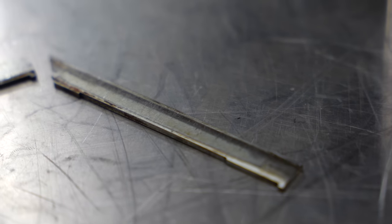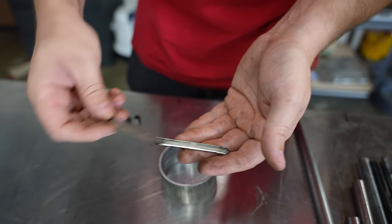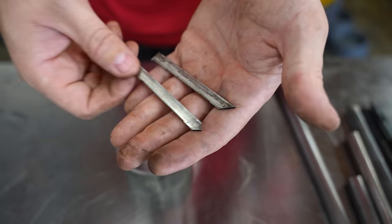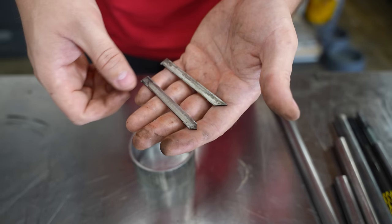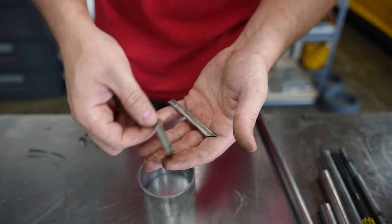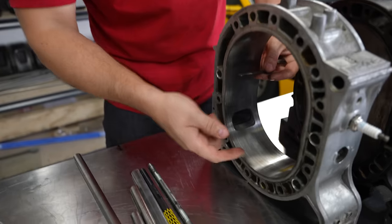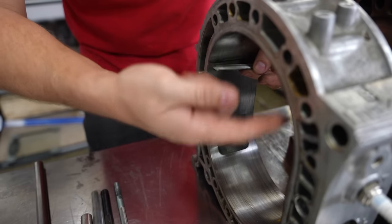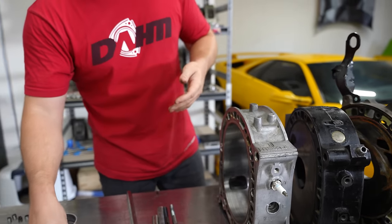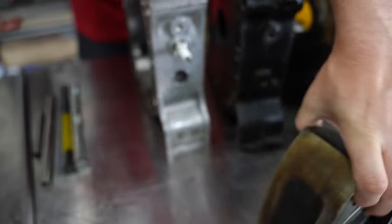And then everybody's favorite internet meme — the infamous apex seal, well at least 90% of it anyway. This is a stock two-piece apex seal with 100% of its piece on there. This is the most common problem you can have when upgrading and tuning a rotary engine. These are not as bad as you think, but they're kind of the canary in the mineshaft when the engine starts having problems. This corner chips off, then that goes through the engine in a beautiful rinse cycle — rips up the housing, rips up the rotors, and can also destroy your turbo. That's when that little chunk broke off and kissed the wall — just destroyed everything.